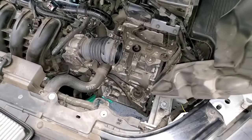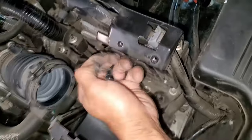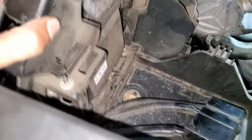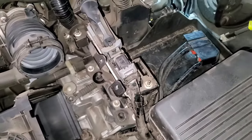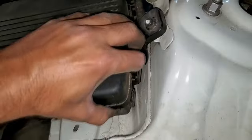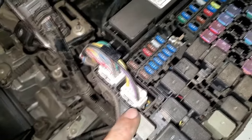With that, the unit is out. The next thing is to remove the top plate that covers the PCM connectors — it will unhook from the back like this. I have removed the three bolts that hold this tray down. Everything here is one unit, so what we need to do now is disconnect this connector right here. There is a wiring harness that connects in here, so we're going to push this tab in and lift this cover up. These are the two connectors that we need to disconnect.